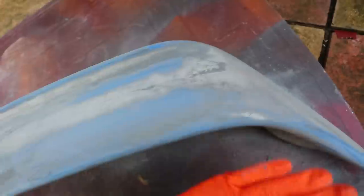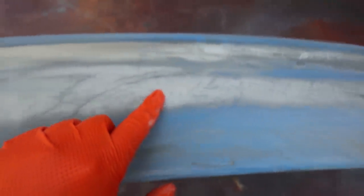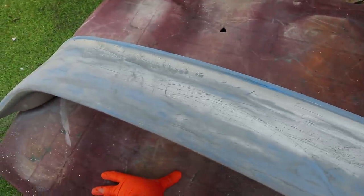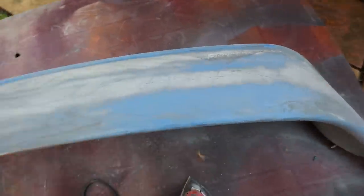So what I'm going to do is sand down as far as I can, even past the primer that I originally put on. I'm going to sand past both the silver and the grey primer, and maybe even into the blue a bit, just so that I don't have this reaction happen again. It's looking pretty good and feels pretty good, but you can still feel a lot of these little scratches. I want to keep going deeper until I'm satisfied it's not going to do this again, because I don't want to put in all this effort and then the same thing happens once I paint it.